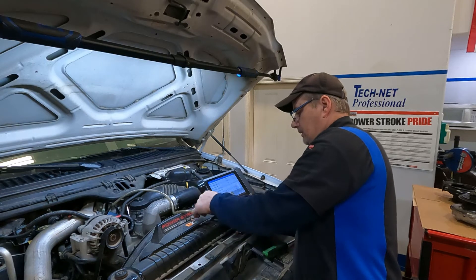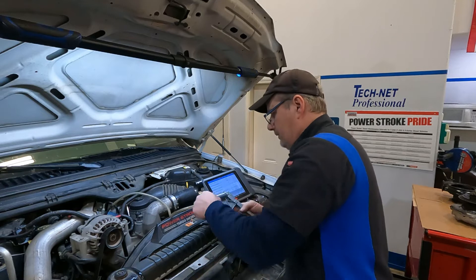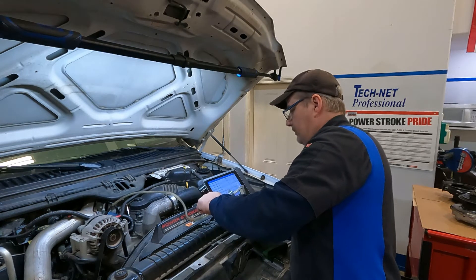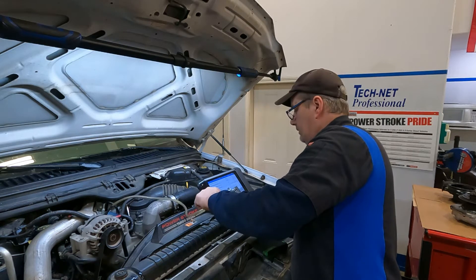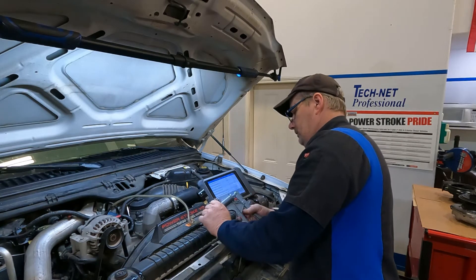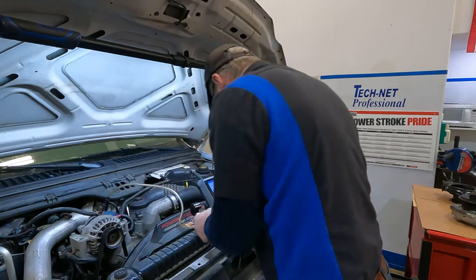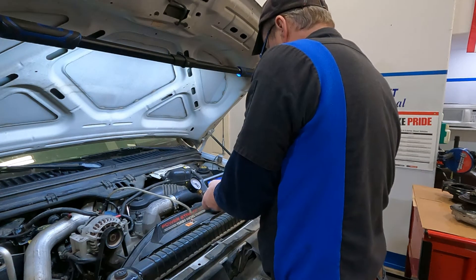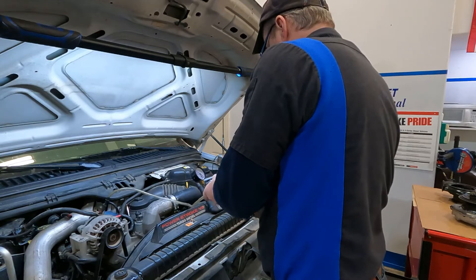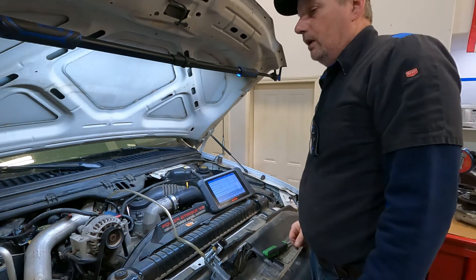It is changing. Now we're going to put some pressure on it and see if it changes. There we go — manifold gauge pressure is going up, and pretty soon it's going to go into its failure effects management. It looks good — it's working. I don't see any problem here; the PCM is calculating my manifold gauge pressure correctly, though in a minute it's going to cut me off because the engine isn't running and it's going to see something it doesn't like.